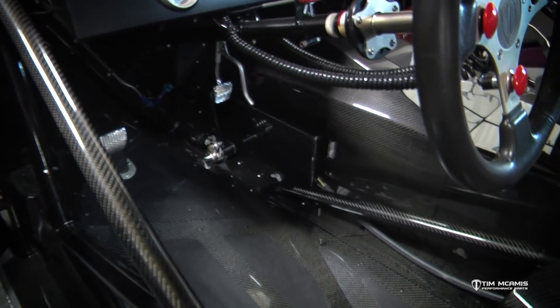You can also use these for exterior pieces — if you wanted to build a carbon fiber look wing, you can use these flat panels to build one. The only thing you have to pay attention to is that the finish on this is not UV resistant. If it's out in the sunlight for an extended period of time, it's going to start decaying the clear finish on it. So if you use it for an exterior panel, you're going to need to clear coat it with an automotive UV clear to give it some protection from the sun.